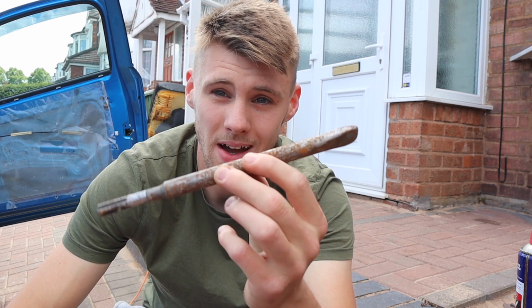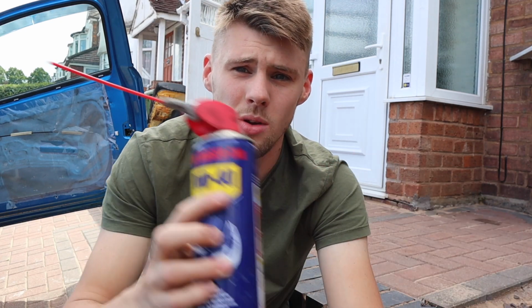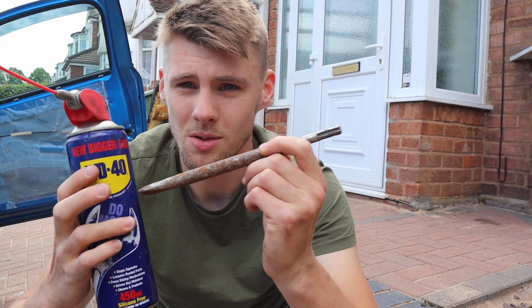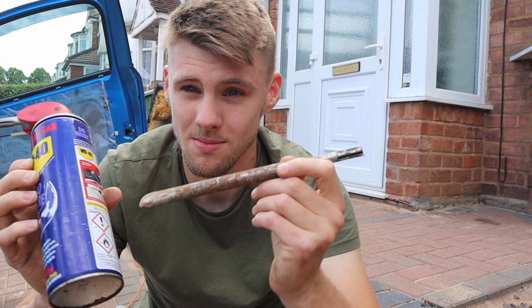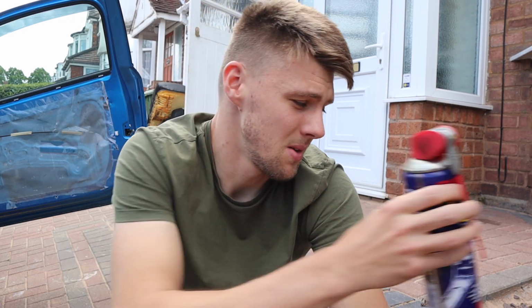Right then, guys, we're in a bit of a crap situation. I don't really know how to get it out. I'm either thinking, A, get a chisel in it and smash it with a hammer and hopefully it spins. I'm going to lube it up with some WD-40 first. The only thing I've got to watch, if I end up using an angle grinder again, is it going to use the fuel as flame? So I definitely can't use the angle grinder again, just in case it sparks and sets the car on fire. So I'm going to use that, and if all else fails, I'm going to have to find my mole grips. I've got some somewhere, I just don't know where they are in this mess, so hopefully we can get this out.